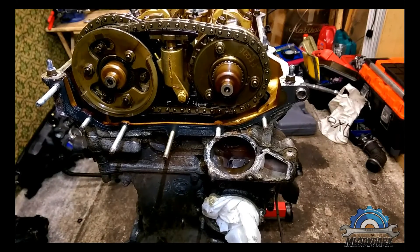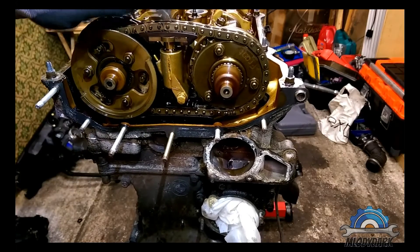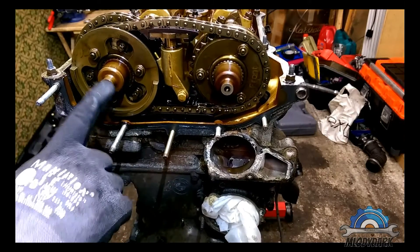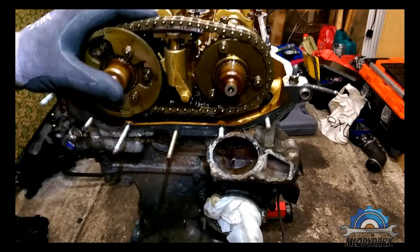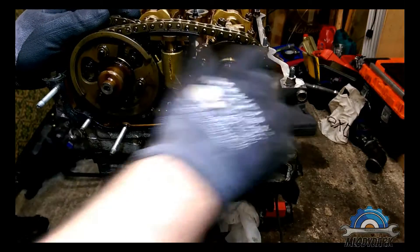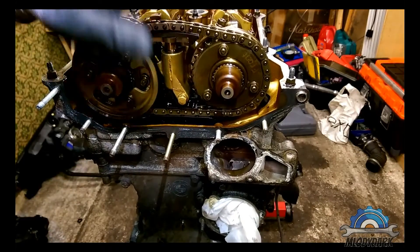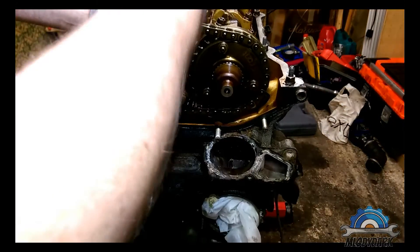If you're changing seals and removing the VANOS, you don't need to align the timing like I said before. But if you start messing around with the crankshaft, you can see that the spline has already moved and there might be a chance of them popping out — however, it's very unlikely. So when you're doing your seals and removing VANOS, don't touch the other side, leave it, and your timing should be fine.